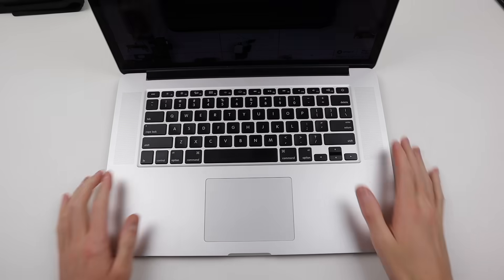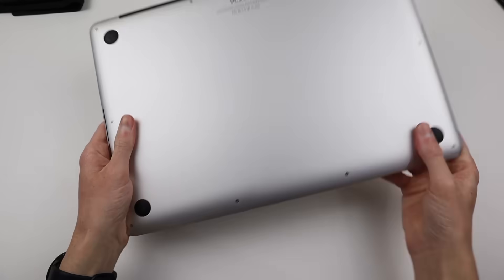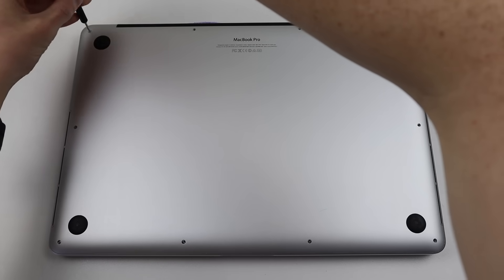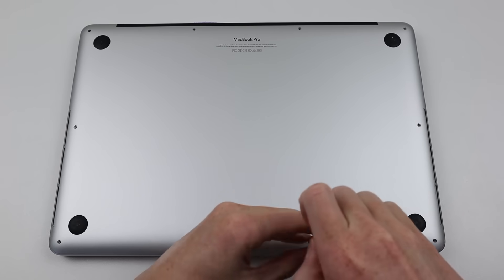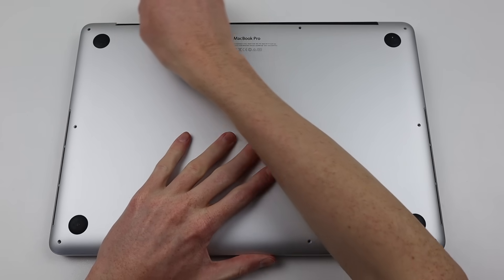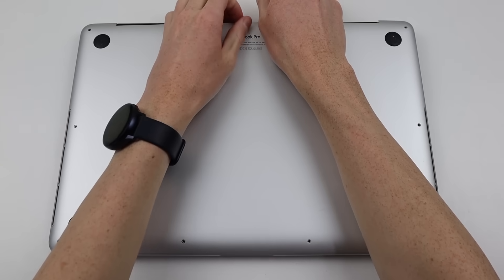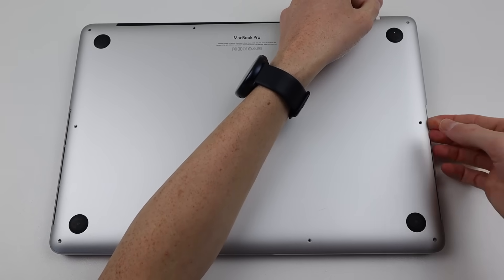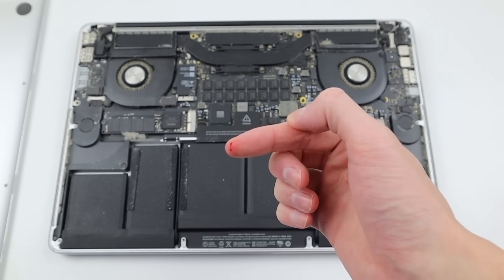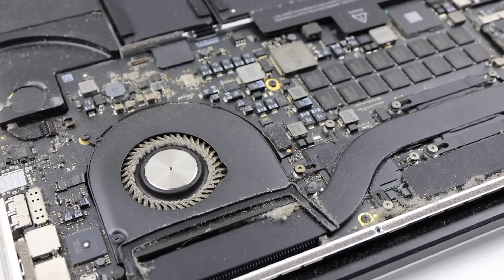To begin, I will shut down and flip over the MacBook Pro. Next, we can remove the 10 P5 screws holding the bottom cover in place. This is our first sign of Apple not wanting us inside our own laptop, given these proprietary pentalobe screws, similar to the ones found on the iPhone. With the screws removed, the back panel is still clipped in with two clips in the middle of the laptop, which can be tough to get undone. You should be careful when removing the back panel, as while it's very thin, it's also razor sharp. I managed to cut my finger during this process.